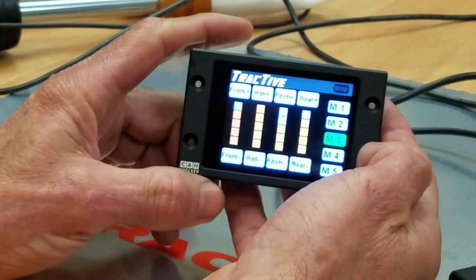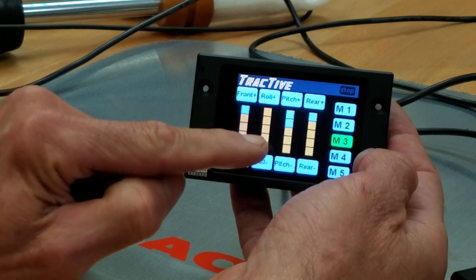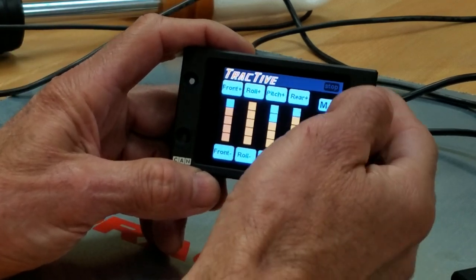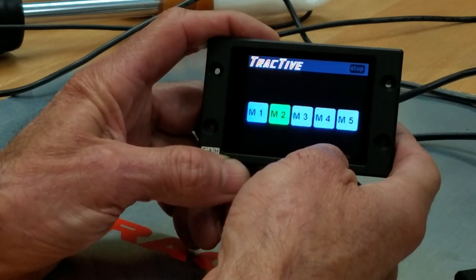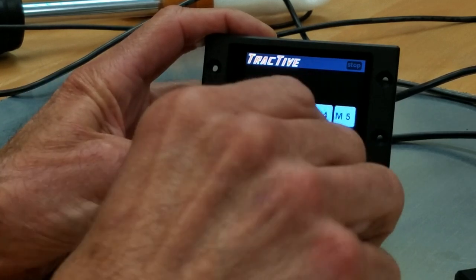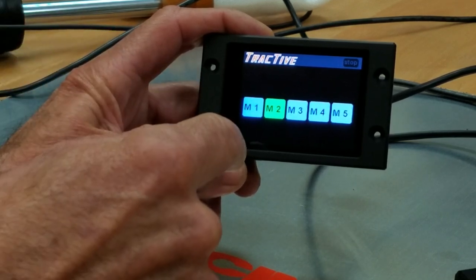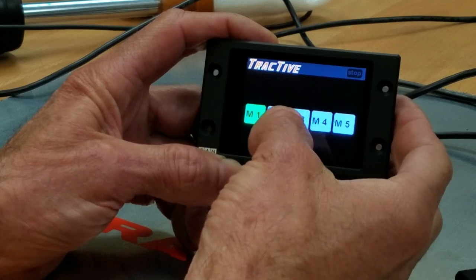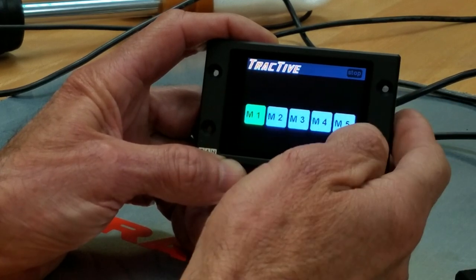My M3 preset — these are just examples, you can do these however you want — would be for a track day with sticky tires. If it's a smooth track, I might want maximum roll stiffness, not quite maximum damping, and maybe medium on the pitch because I like to be able to transfer weight around. This is all driver preference. Once you've got your presets set, you go to the basic preset window and just select — M2, boom — and the shocks change instantaneously. This isn't a stepper motor clicking away; it's changing the entire valving profile instantly. Driving along mid-bump — boom — it's in that setting. You have five presets: different tires, autocross, wet driving, snow, or even drift-o-matic with rear stiff and front soft.